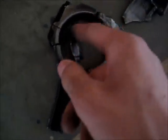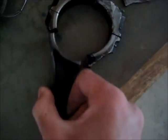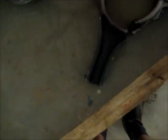Because the bearing's actually supposed to stick in there, but when it spins it turns, gets up here, and there's a big gap here, and that creates a knock in the engine. And that gets hot and builds up friction, which smashes around, and that's how it ends up throwing the rod. But there's what happened to the bearing. Try and get a better view of that in the light where you can see how hot it got. Of course, when there's an oil journal somewhere to get to that bearing and it spins, oil can't get there no more. That's why it gets hot.